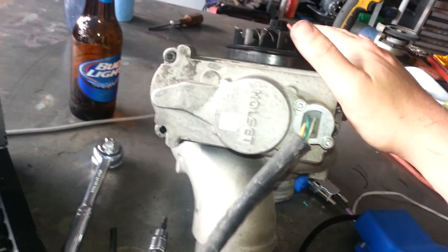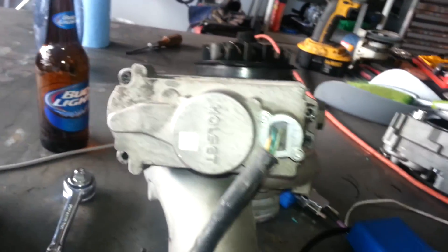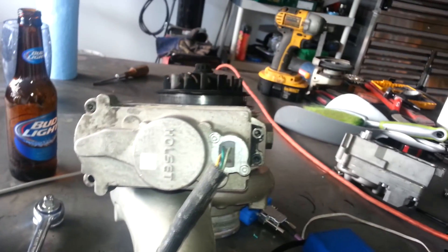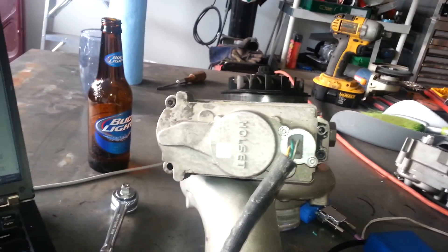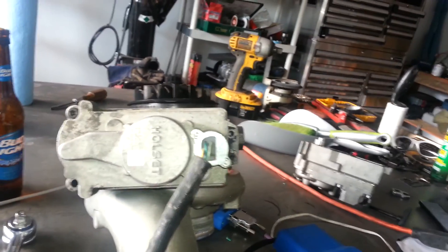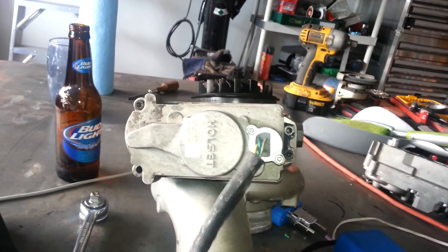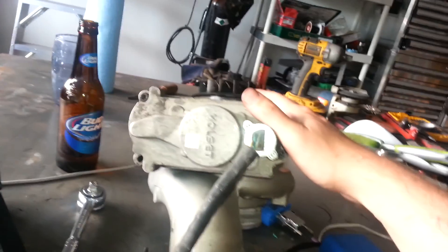It's currently set for my truck, but it'll actually go a little bit further. Right now it's set right around 7 centimeters. The reason I have it set to 7 is because if it's more than 7, it creates excess back pressure and increases the pressure inside the cylinder walls. And if you're not careful and you're forcing around trying to show off your buddies by making your engine whistle or the exhaust whistle, you can potentially damage your piston rings and severely damage your engine. So I have mine set to 7, so no matter what, it'll only close down to 7 centimeters with my programming.